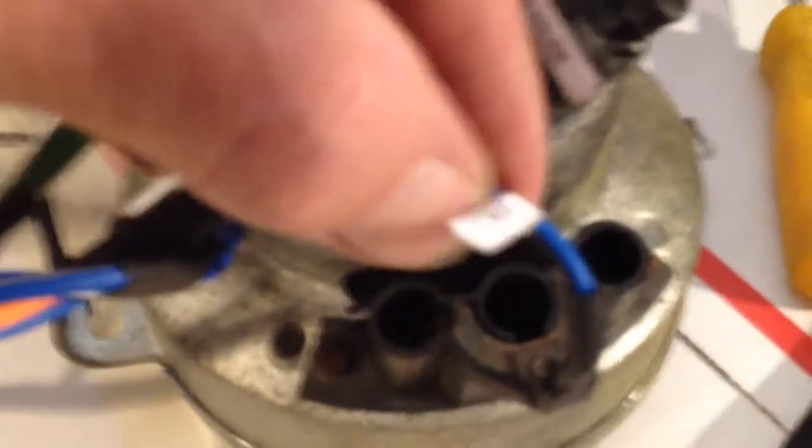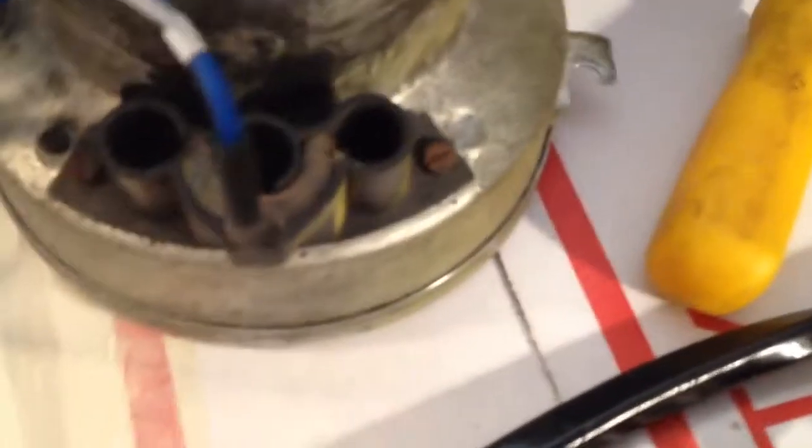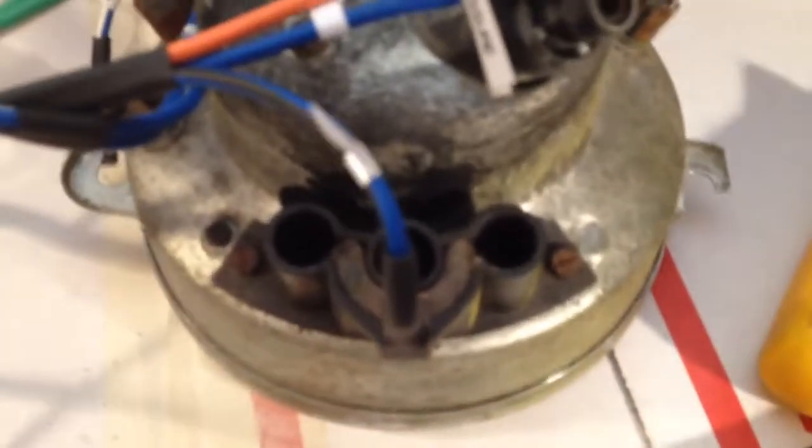I've already gone ahead and screwed in the ground to that spot there — it gives a little strain relief, which is pretty helpful. I've also plugged in the coil wire. This one comes straight from the ignition switch and it powers everything in this little Bakelite job, which is important for our oil pressure sending unit and to fire up our alternator whenever the unit gets going. You want your alternator to charge properly, so it's got to get a little bit of juice at the very beginning to set it in motion. The easiest way to plug these up is to get the bulb mounted on the prong. Bundled up with the coils, the oil pressure and alternator are already there bundled together, so it makes it pretty easy and should be pretty error-free.